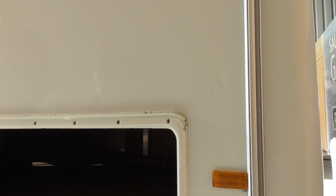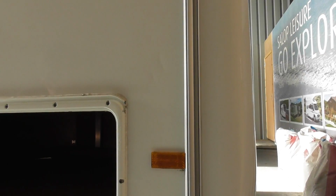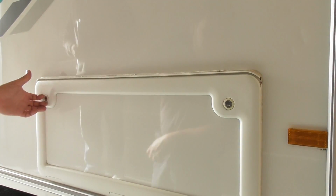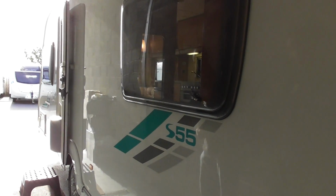You don't want anything heavy on either the back end or the front end of the van when you're travelling. It will affect the way that the caravan tows. So we're talking in here fold up table, fold up chairs, anything light. Obviously, once you're on site, you can stick whatever you want in there, but just for travelling, don't put anything heavy on the back end. Anything heavy wants to be between the wheels, between the axle, in the middle. Understood.